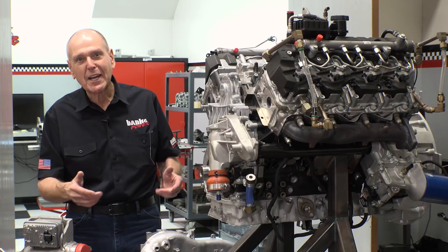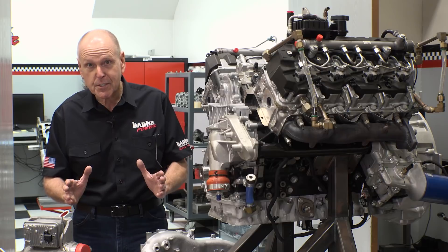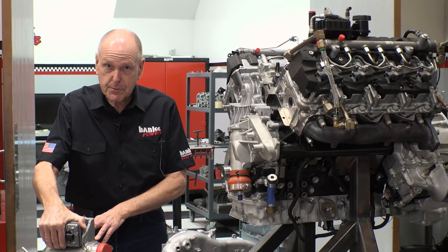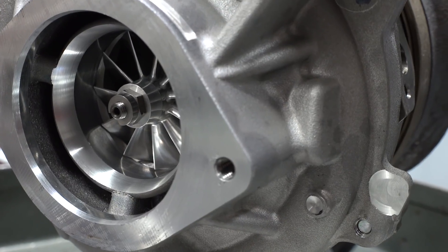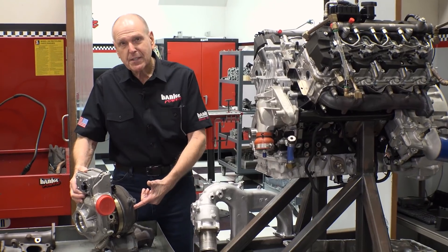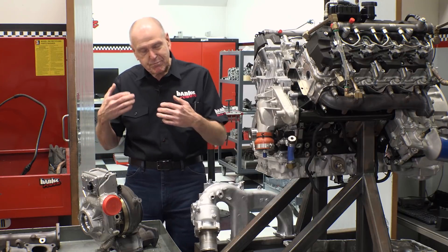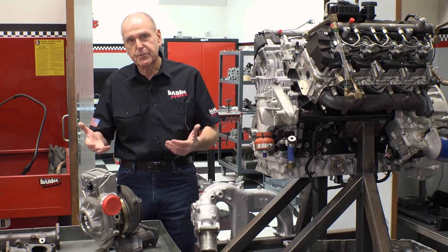We already make a replacement casting for this for military vehicles, but there's no way that thing's going to fit under the hood of your truck. One of the major things I'm looking at is this turbocharger — it's a variable geometry. Borg Warner has a really remarkable controller for the variable geometry, and the compressor has quite a bit of capacity. But it's the turbine that goes into what I call turbine choke. Somewhere north of 500 horsepower, the drive pressure starts going for the moon.